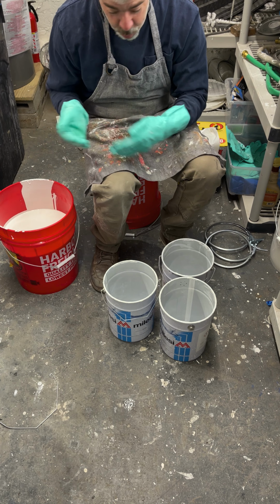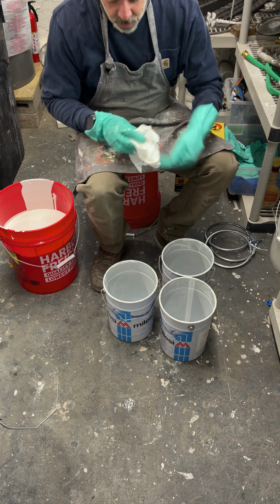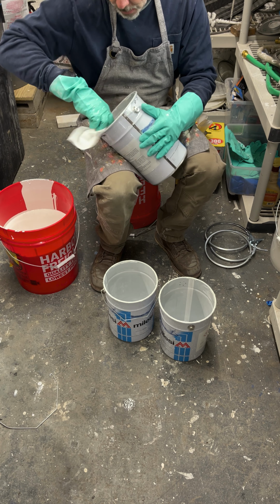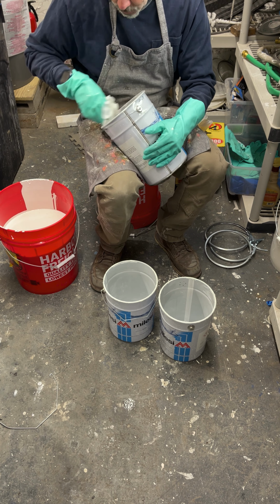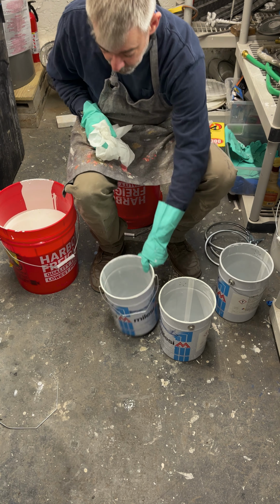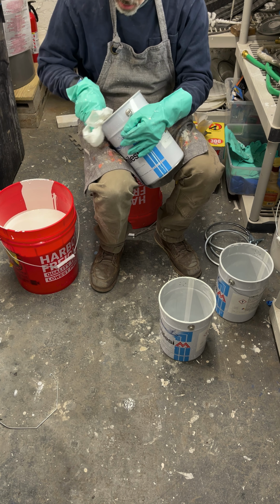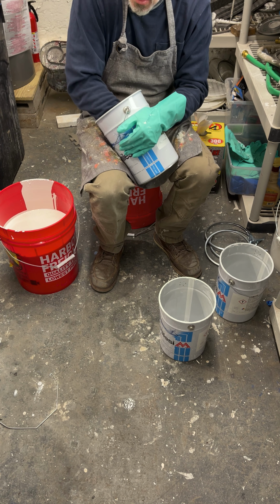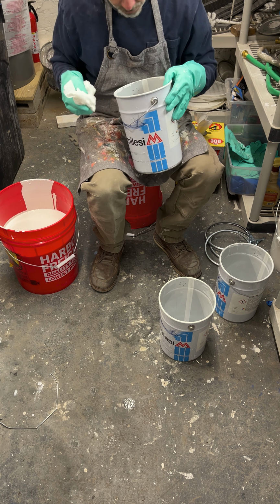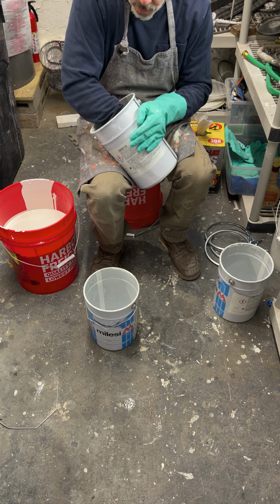So you think that you'd just be able to pour it right into the gallons, but that is not the case. You need to dry it out because, believe it or not, the tap water in here can contaminate the paint. You'd be spraying along, it'd be a perfectly good surface, and then as it dries, it would separate into all these little microbubbles or fish eyes or inconsistency, and you'd have to sand it out, try again. And so you'd basically be contaminating the paint with, you know, either chlorinated water or something like that.